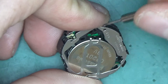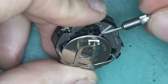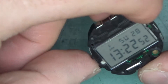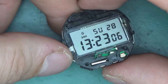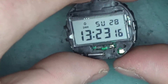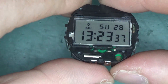That's the Casio watch teardown. If you just want to change the battery, you don't have to take the whole thing apart — just put a tiny screwdriver in and pop it open so you can squeeze the battery out and replace it, which is very unlikely to be needed. It crossed my mind to measure the current draw, but I don't think I have anything sensitive enough. These run on one battery for years. Hope you enjoyed it — please subscribe for more random electronics content. Take care!